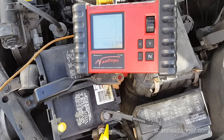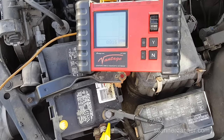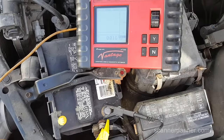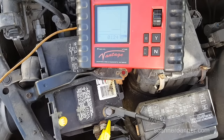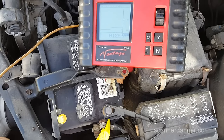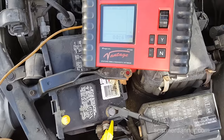We were down — well, it's like double what it was. The thing about a car that sits for a long period of time is any draw is not good. Max, you said you lost the remote for this. Still, 15 to 16 milliamps shouldn't be enough to kill this battery. I'm going to mess around with the doors. Where are we at, Caleb? 0.016.